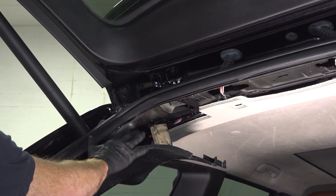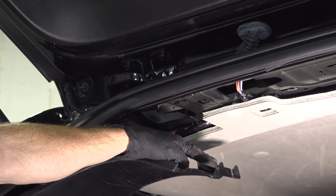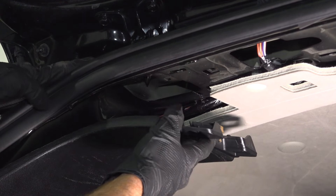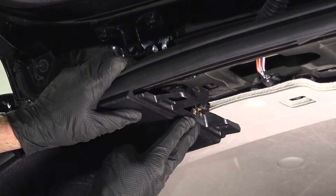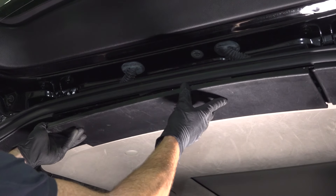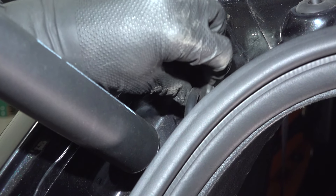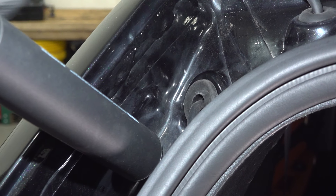One last quick inspection in this area. We'll continue on to re-securing our plastic trim panels — remove our spacer from this area. We need to make sure that we do have that metallic clip on here. Ours came off, so I'm going to go ahead and slide it right back on — it just presses right on. A quick confirmation it's properly secured. Now we can start aligning this and pressing it up into position, getting that metal clip up into its locked position. Let's get our plastic panel on the top there, getting it aligned. In this area, we'll be installing our rubber plug — we want to ensure that no moisture or miscellaneous debris makes its way into the passenger compartment. Just gently flex it into position, give it a light tug, and make sure it's properly secured in place.